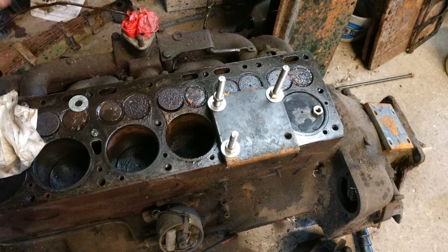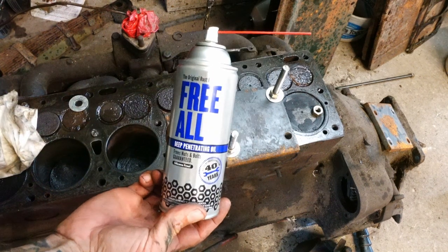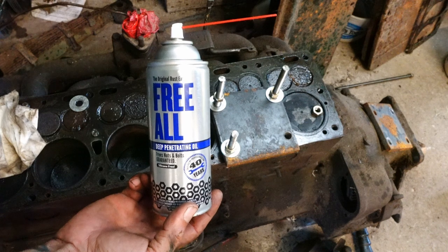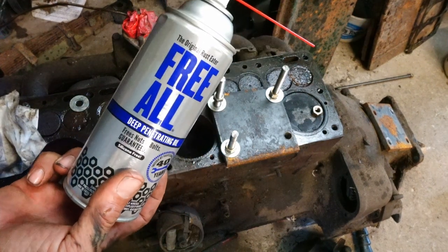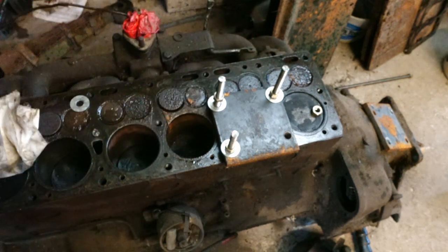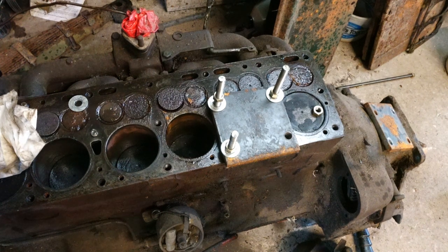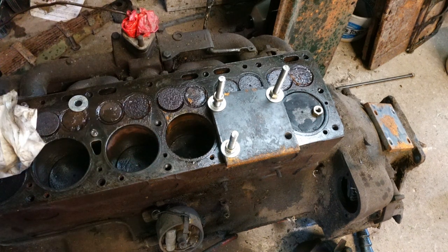Before we did this, we soaked the cylinders for about 15 minutes with free oil. We're not sponsored by this, but this is just the best stuff we've found. The second best thing you could probably use is kroil oil or something — PB Blaster's not bad. Don't use WD-40. If it doesn't work right away, just leave it under pressure and go by and tighten it a little bit every day. See if you get some results, or try striking with a hammer.